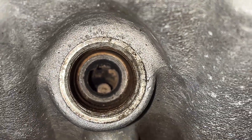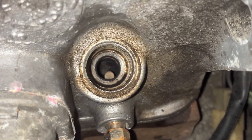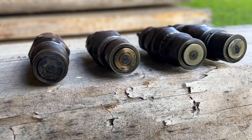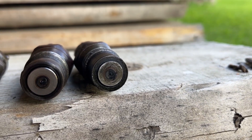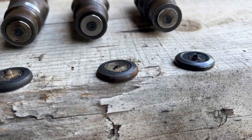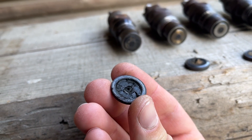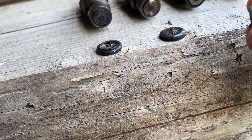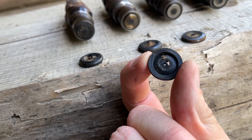The rest don't have as much, and all the injectors came out pretty easily, but the last one was kind of crunchy. The first injector has all that carbon, the second is a little discolored, the third is the best looking one, and the fourth is all scratched up. The washers look similar from the bottom side, but the top side is just filled with carbon on the first one. The rest look similar, except for the last one which has a hole blown through it.